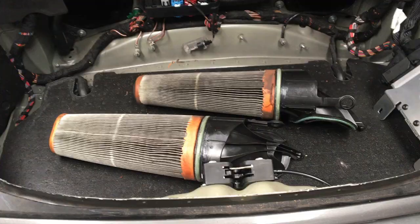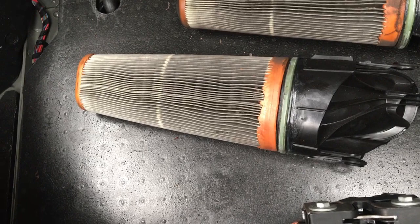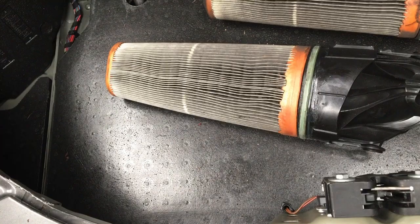I've just pulled both of the air filters, and whilst they're obviously dirty as you would expect, they are perfectly dry — which is fantastic news. Because one of my big concerns about a car that had a lot of water in it was possibly that it had been driven into water and ingested water, and clearly this hasn't been the case. So that's great news. Basically, the engine should be pretty good.